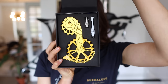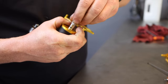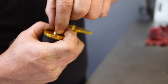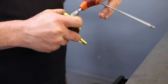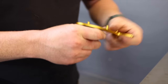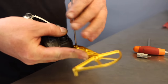Make sure you have the small tool that comes with the Kogel Colossus oversized derailleur cage. Go ahead and put the nut back on using this tool. When you tighten it up, make sure to leave some room to adjust the spring tension after. This is an important step: turn the cage one full turn to preload the spring. Once you adjust the tension of the spring, it's time to put the derailleur cage back together.